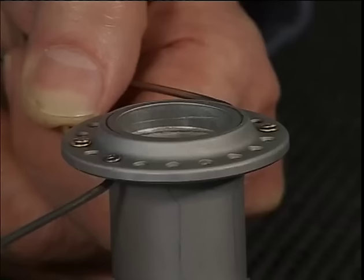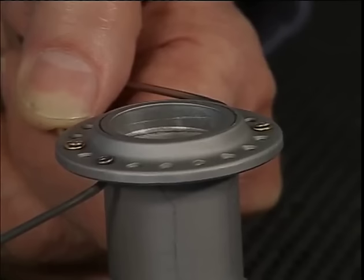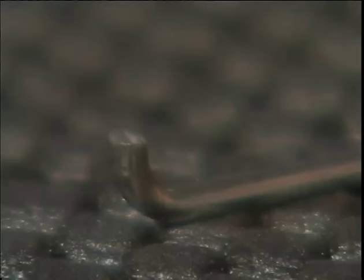The second cause of spoke failure is the play between the spoke and the hub flange. The connection between the hub and the spokes are put under stress by the load changes. If the spoke sits without play, nothing happens. If there's a bit of play, the spoke elbow moves with a jolt at each turn of the wheel. It becomes stressed and the material becomes brittle. The spoke breaks.